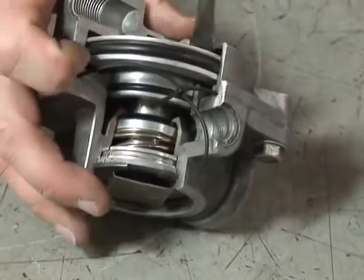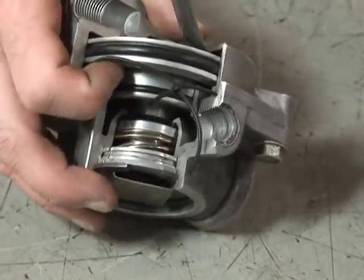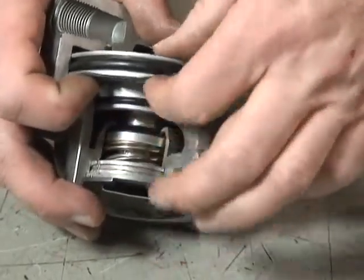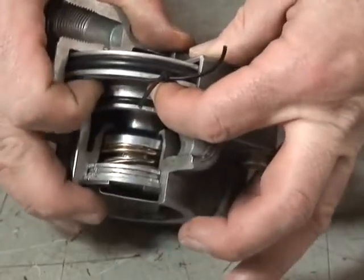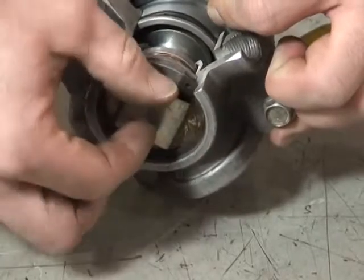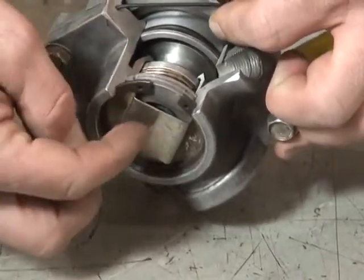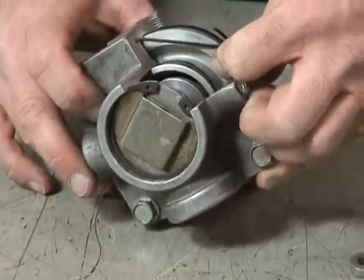When the signal is taken away and the driver lifts his foot off the treadle valve, air will be exhausted from the top side of the relay piston. The 20 psi or whatever is on the bottom of the piston will cause it to move up, opening the exhaust port, and we exhaust any air in the circuit from the service brakes back through the exhaust port on the relay valve.